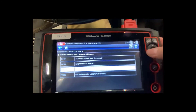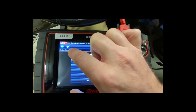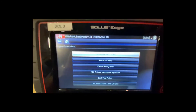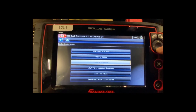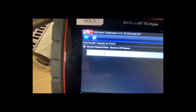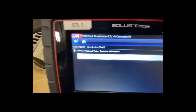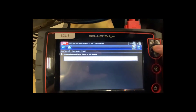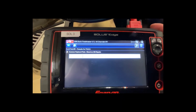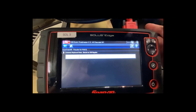To get out, I can hit the no button or the back button. The home button takes us back to the main screen — you don't really want that unless you need the main screen. The back button is how to navigate back. Going into 'message requested' shows what is actually turning on the malfunction indicator light — it's just the secondary air injection code; that's the only reason the check engine light is currently on. The other codes haven't occurred frequently enough to turn the light on, or they occurred, the light came on, they stopped occurring, and the ECU turned it back off.